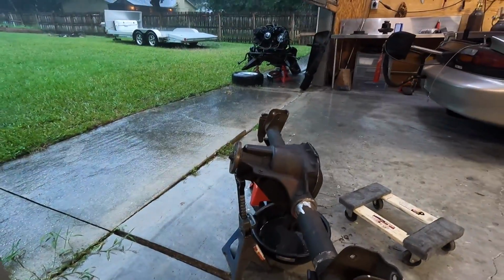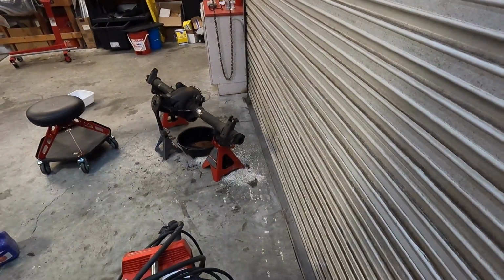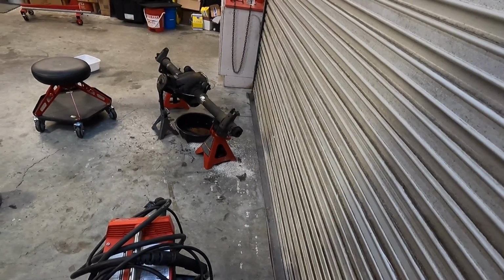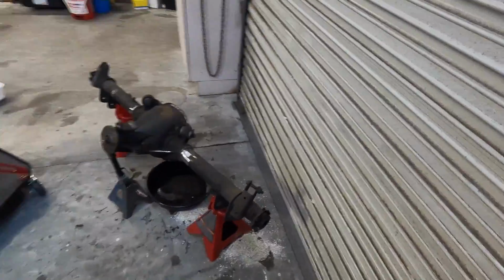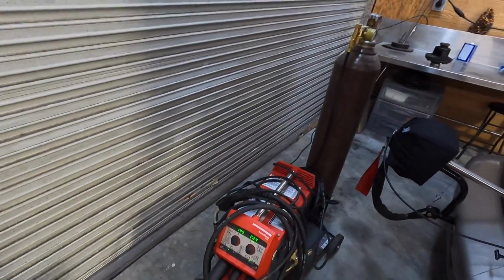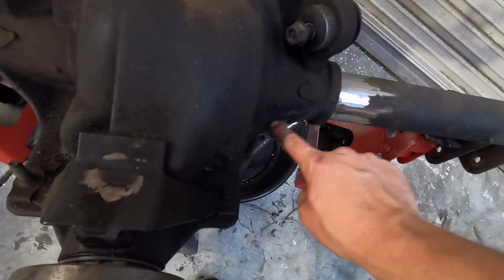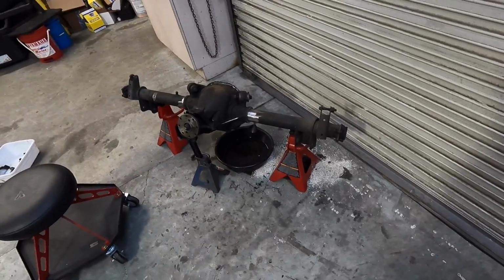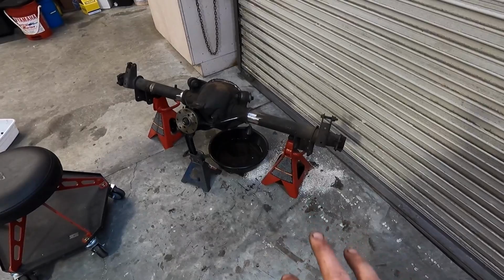Okay, well, I'm going to get back to grinding. All right, well, I'm both excited and scared to try my hand at this over here. Fronius TransSteel MIG. This thing is a good machine, and let's get it set up. So I ground down this little spot so I can ground it, and then really just need to let her eat. I'm going to try to be very careful because I don't want to put too much heat into it and warp it.